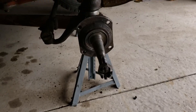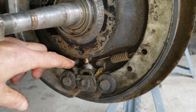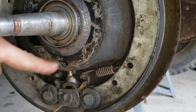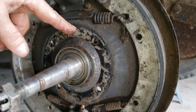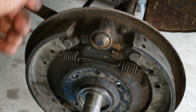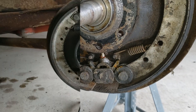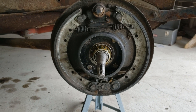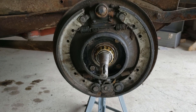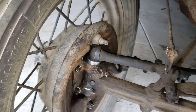I have the backing plate on now. I want to just point out how I got that pin lined up — the pin goes all the way from here, through the kingpin, all the way up to the top mechanism back here. Just wanted to show how that went back together. Backing plate complete, ready for the wheel. Let's see how that goes.